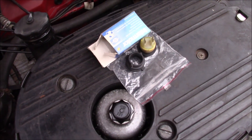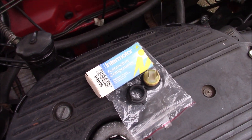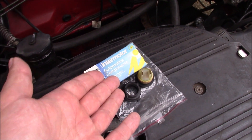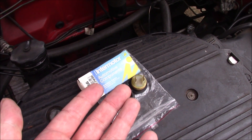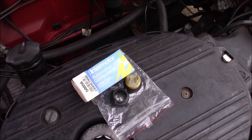I did test it, and this is an old Intermotor branded one. So previously I'd bought a brand new switch — this one's more likely new old stock. It tests properly in boiling water. You can actually hear it make a very, very slight click as the switch inside engages.